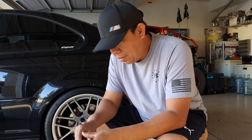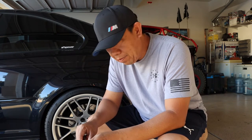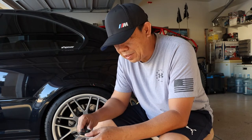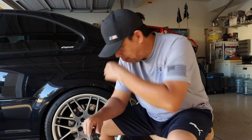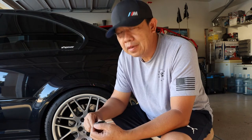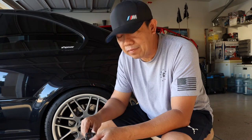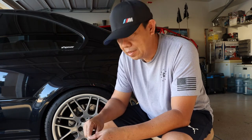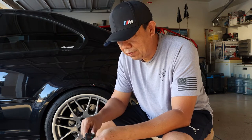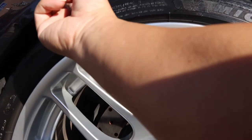Today I'm going to change out my rear wheel spacer on my E46 M3. I'm using a 15 millimeter spacer in the rear and it does rub — I told you guys it doesn't rub on the rear, but I just found this out a couple days ago when we drove to the San Diego area. I keep hearing a squeak sound when I go over uneven pavement or a little bump and dip. Only the rear is scrubbing, and when I got out of the car to look, there it was — a scrape on the tire.